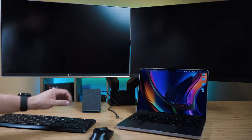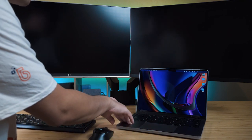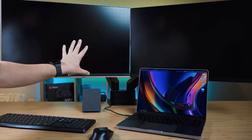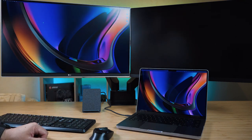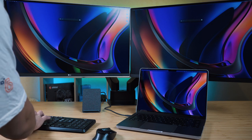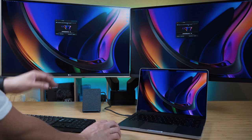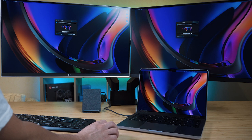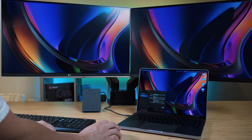Now let's have a look at how the HD22Q reacts with a 14-inch MacBook Pro — this one has the M1 Max chip. The monitor on the left is connected by DisplayPort and the one on the right by HDMI. One has fired up, and the second one has fired up too. However, I can see it's in mirror mode. Going to display settings — we do have 4K running, the scaling is quite small, but we're only able to get one display extended. The two externals are mirrored, so the two monitors are mirrored.